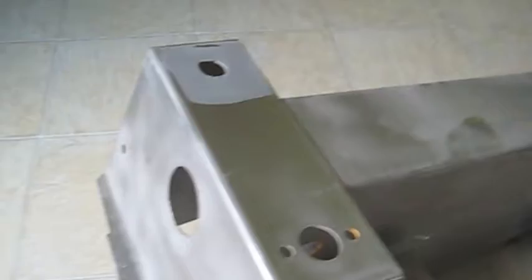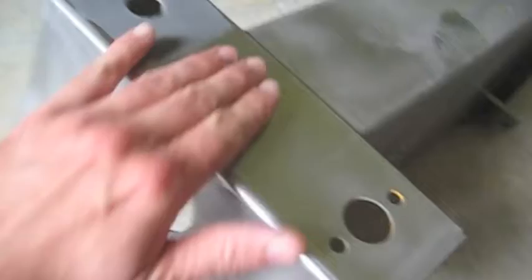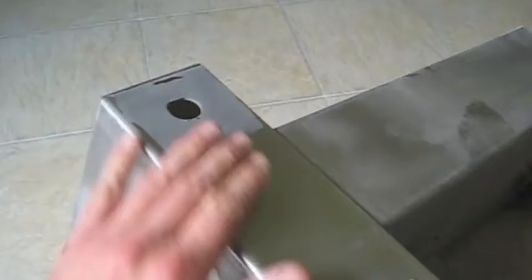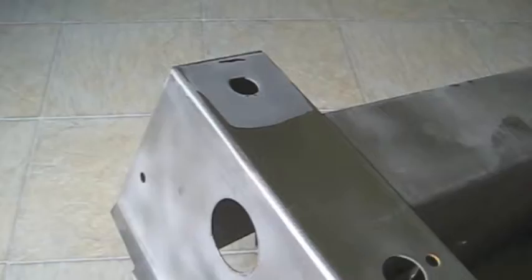I'm doing a little body work here. The key switch area was dented for some reason — it wasn't flat. I had to flatten it with a body work hammer, which straightened it pretty much. It still had dimples from the hammer, so instead of using Bondo I used JB Weld, spreading it real thin to cover it, then feathering it with a palm sander — the oscillating kind that goes circular and also rotates so you don't get scratch marks.